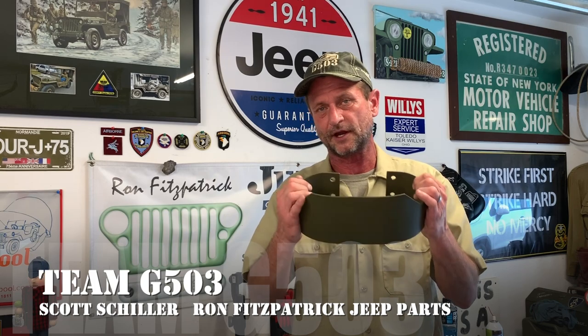They are made of what is called spring steel. Spring steel can be a medium or a high carbon steel content steel. They actually make springs out of them — that's why they're called spring steel. The idea is it has high yield strength, so if that's hit, it's got a good chance of not getting crushed and returning to its original shape.